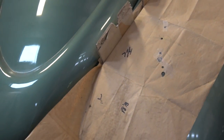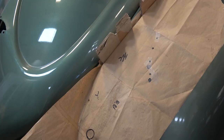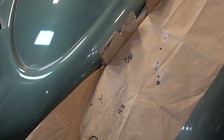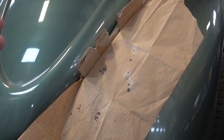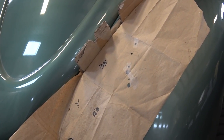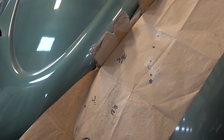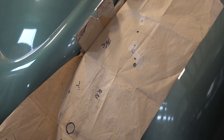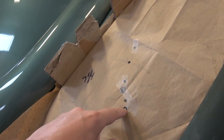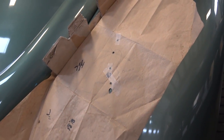Following the picture, you'll be able to come up with these holes, and that's exactly what I did. When I did a rough placement of the tail light it actually came out just right. Very good information I found on the Samba — that is a very useful website for stuff like this, especially for vintage Beetles, because brand new aftermarket fenders or anything '62 to '67 are not going to have the hole placements right. If you have the correct original fender it should have those holes already. You make your measurements, mark it up, make a little hole on the paper, and now you've got your placement for your tail lights.